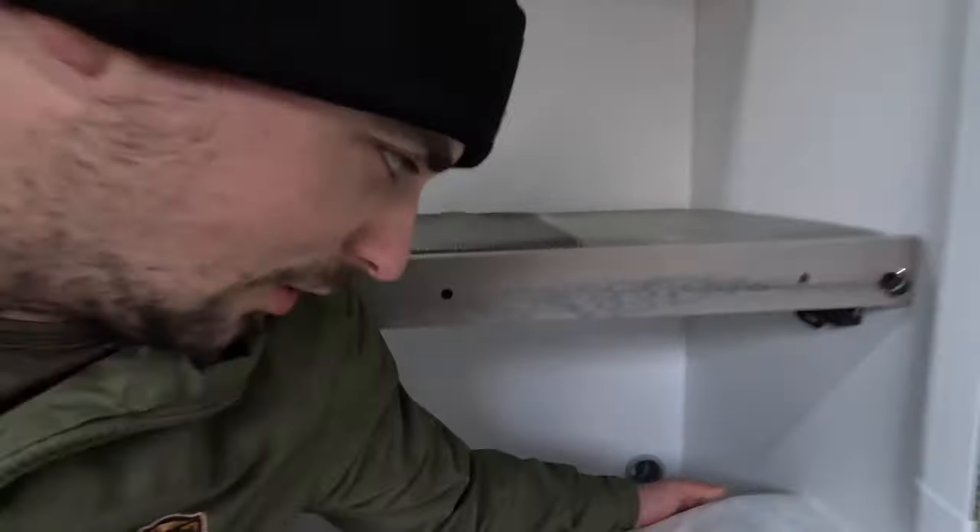Let's hop inside. We're in here and guys it feels great — we've got really cold temperatures outside and in here it's warm. We've got the furnace running on low mode off the battery, so it's strictly running off the electric from our 300 amp hour battery. It took about 35 to 40 minutes to get from freezing to 60 degrees, and now it's just on eco mode. The air is coming out of those two outlets in the back end, keeping this camper warm strictly off the batteries, and the sun is recharging the battery as we speak.